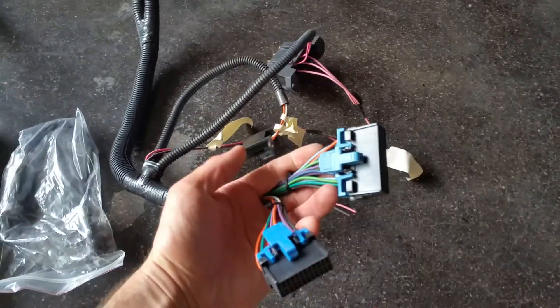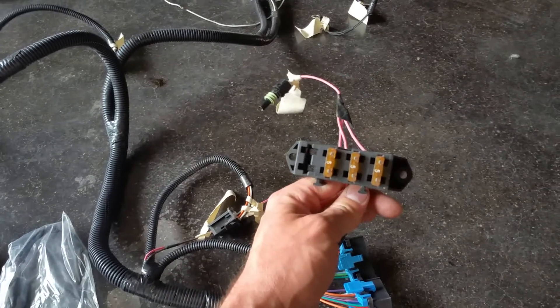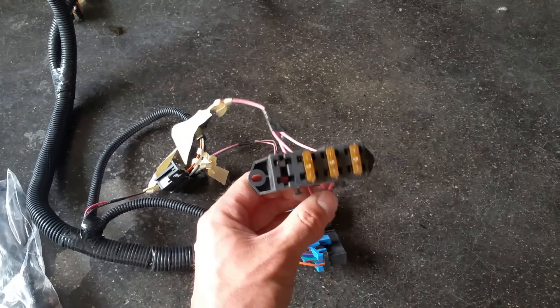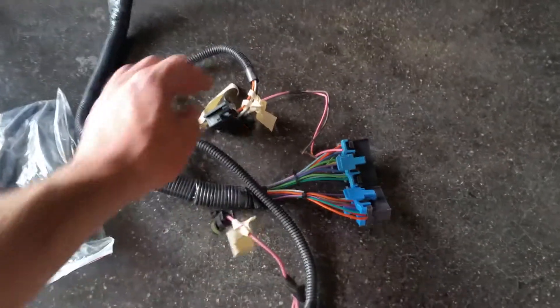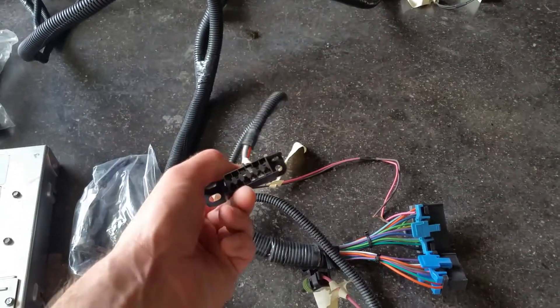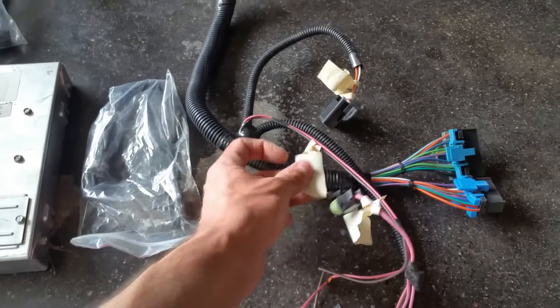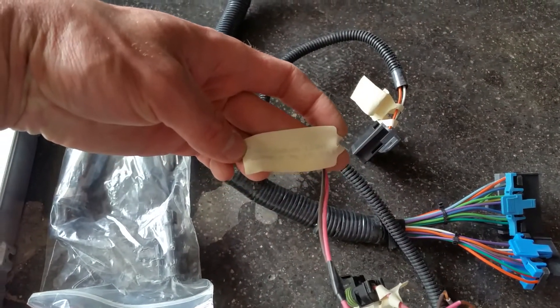The wiring harness has just two plugs that go into your ECU, and you need to give switch power to your main fuses. Those 5-amp fuses are mainly for the injectors. There's one other 5-amp that I'm not sure where it goes, but on the Megasquirt build you just need two 5s. This one might be for the oxygen sensor. They actually have a diagnostic port on one of these that you can probably flash out, and it gives you a wire that goes to a light bulb so you can connect a check engine light and tell you if there's any issues with your sensors.